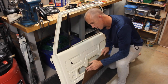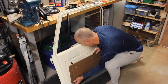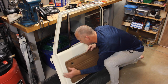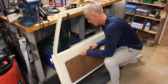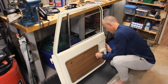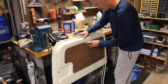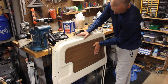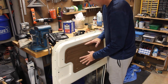Now just press the door card — these little prongs — in through the holes. It's more of an alignment issue than anything else, so it shouldn't be too hard. Start in a corner and move around, adjusting as you go. Flip it upside down to see the lower clips more easily. It's starting to look really good — there's a slight bow to it, but nothing to worry about.